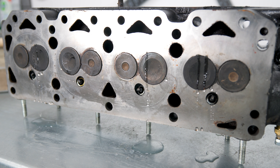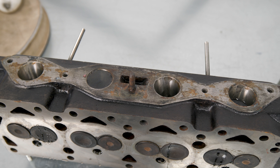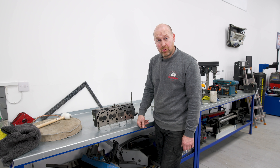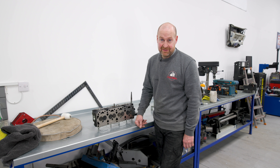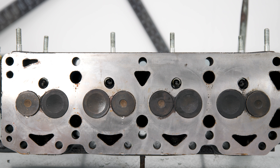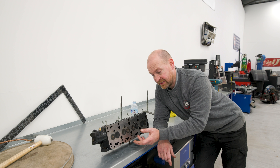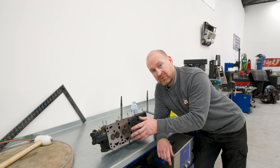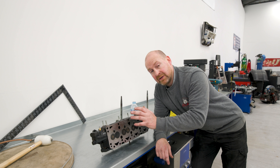Well, I guess it's lucky I checked the rest. I flipped it upside down and poured water into every one of the inlet ports, filled them dead to the brim. Cylinder three, even though it's leaking a little bit, stayed pretty full. Cylinder two and cylinder four are pretty much empty — look at my poorly little head having a little cry. I'll flip it back over and check the exhaust valves as well. So that's all of them tested. The only valves that are any good are the inlet on cylinder three and the exhaust on cylinder four — all the rest are leaking. That'll give us our low compression, and with number two especially, as soon as I'm pouring water in, it's pouring straight out past the valve. That's why compression is coming back up through that carb and squirting fuel all over the inner wing. So let's whip every valve out and seat them in properly.